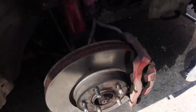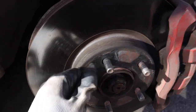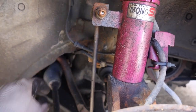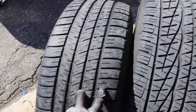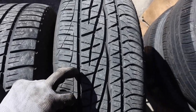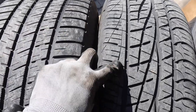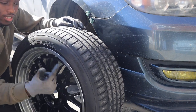We got both wheels off. Like I said, we're definitely going to need some extended studs for the fronts because these wheels hit against the brake caliper without a spacer. I also need adjustable end links, which I do have, but I'll put those on in a different video. You can already see how this wheel is much wider — this is 18 by 9 versus the old one which is about 18 by 7 or 8. I think this might actually be 18 by 8, so just an inch more, but the offsets are obviously different.